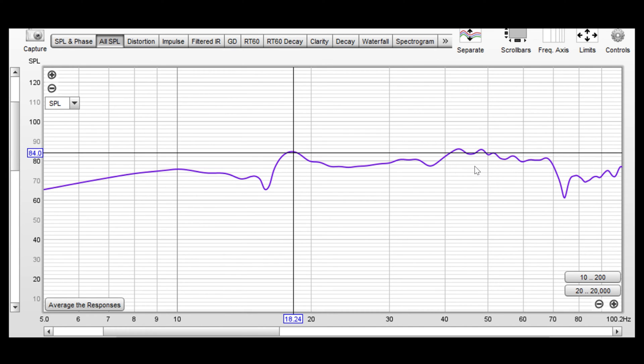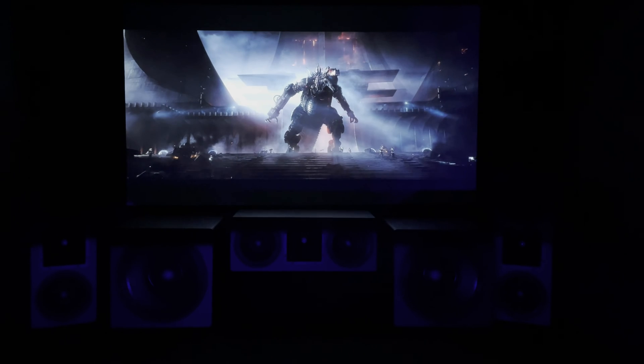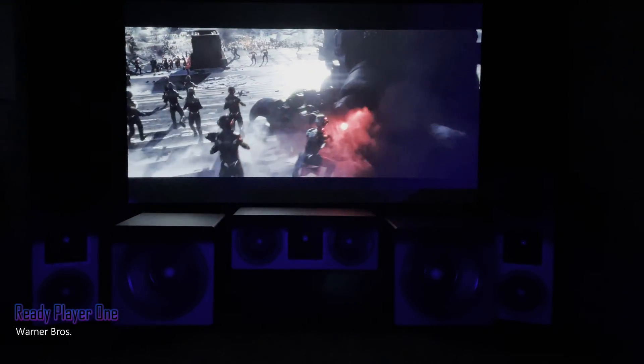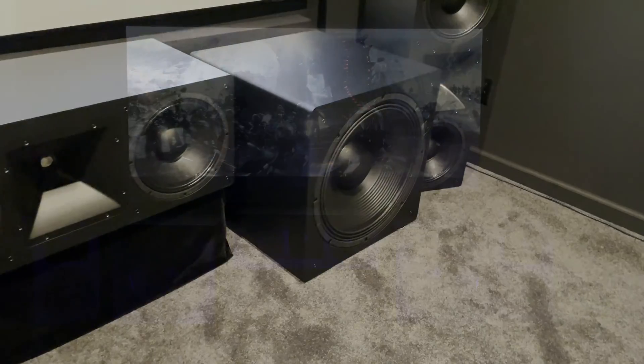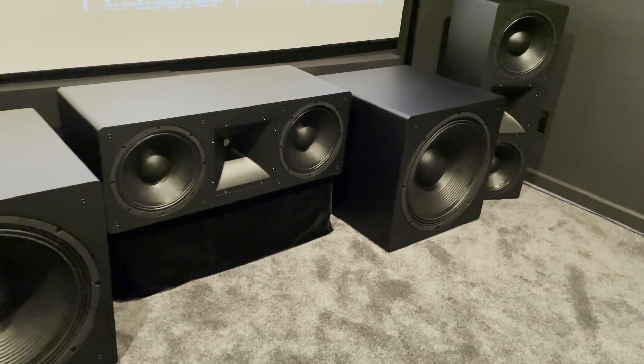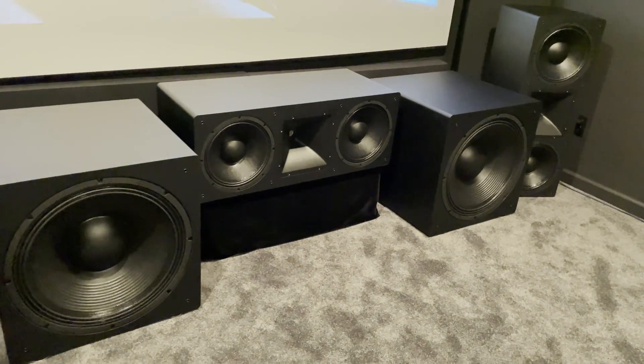I did not experiment with subwoofer placement — I may try that later to see if that helps at all with this dip around 16 hertz, which if you've seen any of my other sub reviews is always present. There's also a dip at 74 hertz I could not clean up, but this is where I am now. Beyond the measurements, what is the real-world experience with these subs? For me in my space, I was impressed with how it fills my home theater. There's so much bass and pressure, and as you may imagine these 21-inch woofers absolutely pound. These are definitely able to dive deep into those lower frequencies. I'll play a few clips — they won't sound remotely the same as they do in person, but you will be able to hear what I demoed.